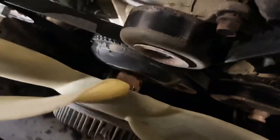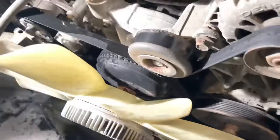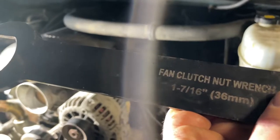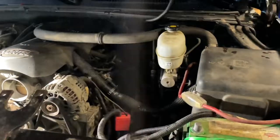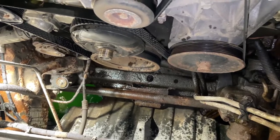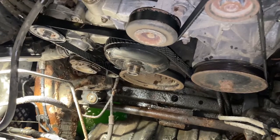Once you crack it free you can just spin it right off — you can see the nut moving now. All you gotta do is crack it free that little bit and then it comes off. The spanner tool has little notches that fit into the holes to lock the pulley. On most Chevy trucks it's going to be a 1-and-7/16" or 36mm wrench; a breaker bar comes in handy too. We got our clutch fan off. We have a separate video on that — search 'Fur Curl Chevy truck clutch fan removal.'